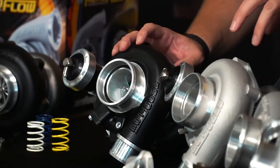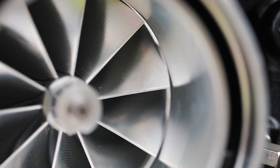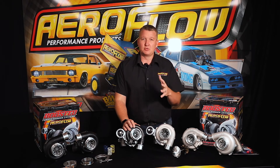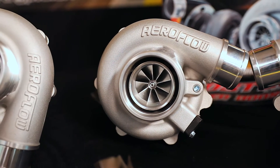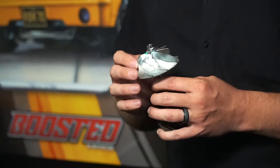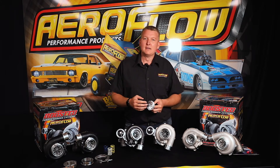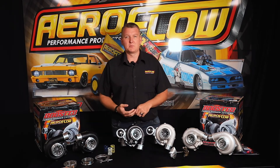One of the key features is the point-milled 7075 billet compressor wheel. Point milling is a term that's becoming more common in the industry. The key is the aerodynamics of the compressor wheel — it's a different version of milling. Traditionally, billet wheels in most turbos on the market are flank milled, which means a flat surface on the leading edge of the compressor blade. With point milling, you can see this dimpling or additional milling that happens in the 5-axis CNC machine. That increases the aerodynamic efficiency of the compressor wheel, allowing it to move more air more efficiently — lower turbine speeds, but more air being moved and compressed. That's where we get the higher horsepower from these.